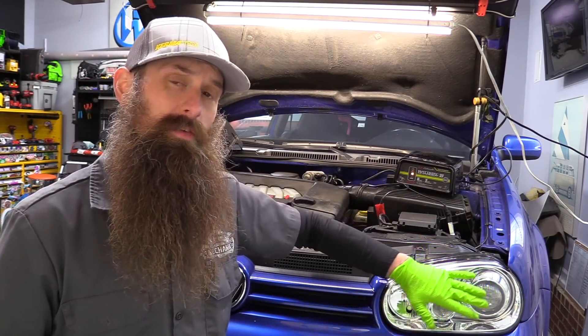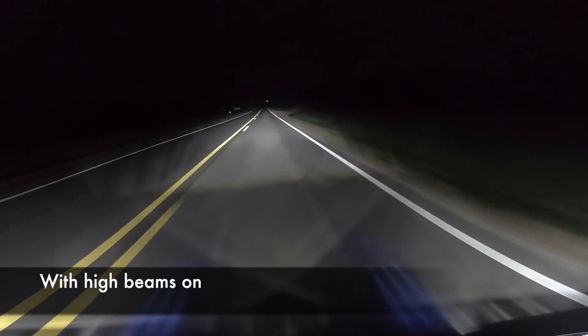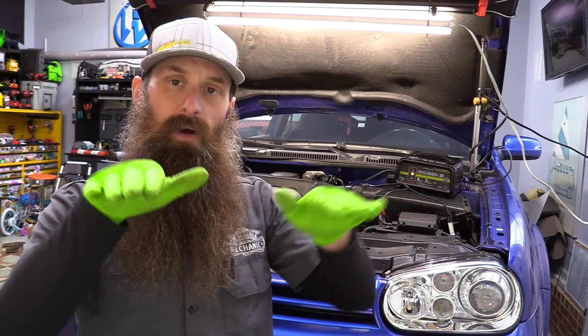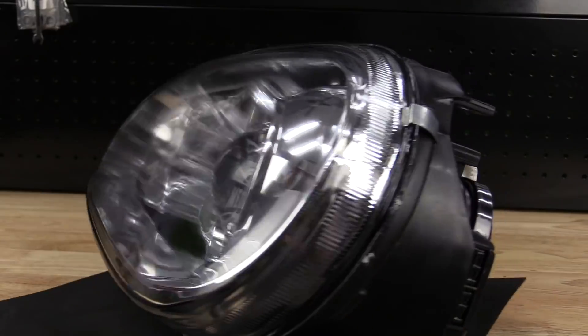Our headlights are in and they look amazing — I'm super excited. I will also be installing a Lamin-X cover over these to help protect them, even though they're glass lenses. Now let's compare some light output. This footage here is of the original headlights, exactly the way they were before we pulled them out and replaced them. And this is the light output from the LED upgrade. These lights might also need a little bit of tweaking on the aim — the way I like to check that is to park about 10 to 15 feet from a wall on a level surface and see where the beams are. If they're pointing up and away really far or down at the ground, we need to tweak those. Mike does a great job of getting these headlights aimed before he even sends them, so you might just have to do a little tiny bit of tweaking. There we have it — the upgrade you guys have been asking about for a really long time. Hope you enjoyed that. I'll put links to the lights and everything we used today down in the description. If you guys like this video, give it a thumbs up. Don't forget to subscribe. Have an awesome day, and I'll talk to you guys again next time.